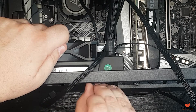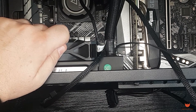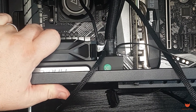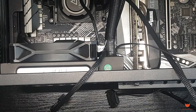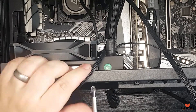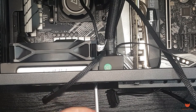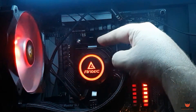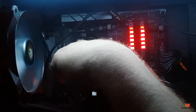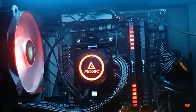Now you need to install the radiator into your case. With it being a 120mm, it makes sense to place it at the rear. Simply replace the existing rear exhaust fan and secure the radiator using the included screws and washers. Next, hook the RGB cables to the controller or the onboard addressable RGB points and connect the SATA power cables. You can tidy up the cables a bit more — bear in mind there are four cables in total to route, and some are excessively long.